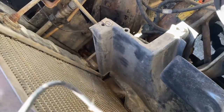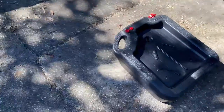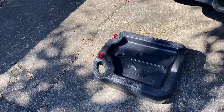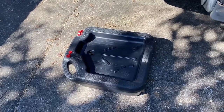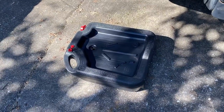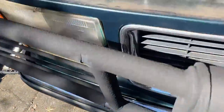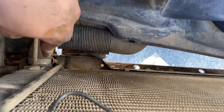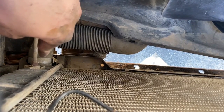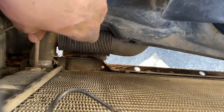What we're gonna do is go underneath. We have this drain pan right here because we don't want coolant getting all over the ground - very bad for the environment, very bad for animals. So we're gonna put that underneath and try to catch as much of it as we can. It's a 16 quart - I think it'll be enough. We're gonna loosen this lower radiator hose clamp right here and do our best to get the drain pan positioned under here, then work the hose off little by little. You have to do a bunch of twisting to break the seal.